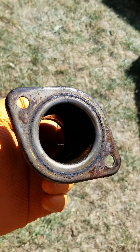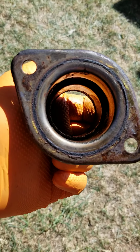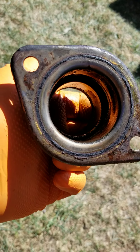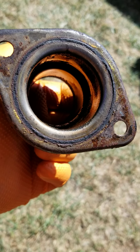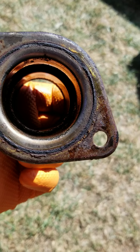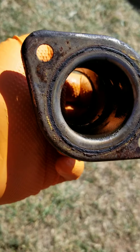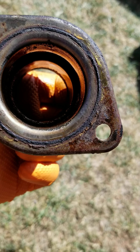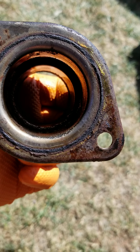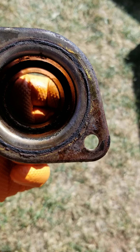Like I said, you're going to smell it — that's going to be one of those 'I know it's leaking antifreeze, I just can't find it.' If you can't find it visually — no drop, no white residue, no spray — if all you're able to do is smell it, this is possibly why. A water pump, if it's leaking, is going to show you. You'll see the white residue as it dries if it's that slow or tiny of a leak.